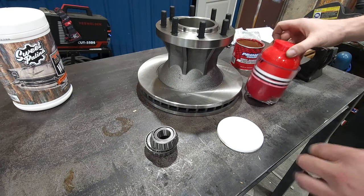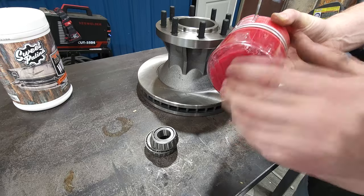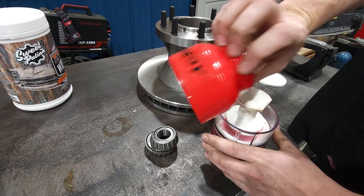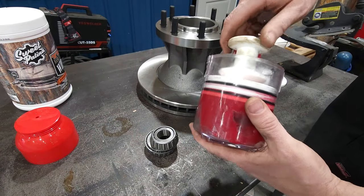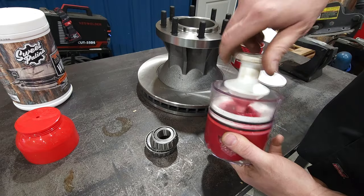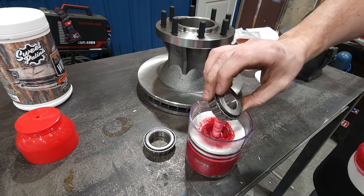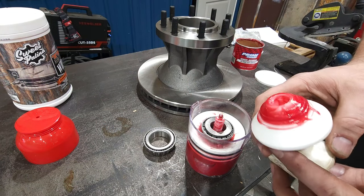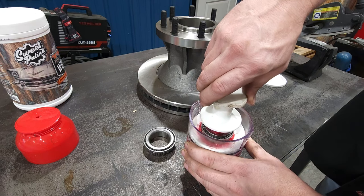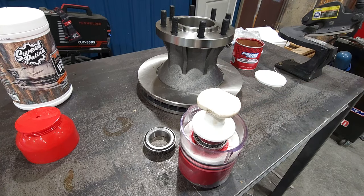Now, I've got this bearing pack, or the bottom half, that's just all the grease that's kind of staying stored in there. There's a separator between two O-rings so that stuff doesn't blow through. Just to cover here, nothing too crazy. And this just screws off here. Basically, you drop your bearing down inside of there. This taper on this cone here is going to sit down inside of your bearing, kind of centered up a little bit. Don't have to go crazy, just get it snug on there.